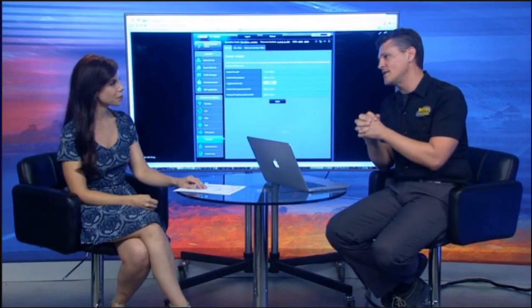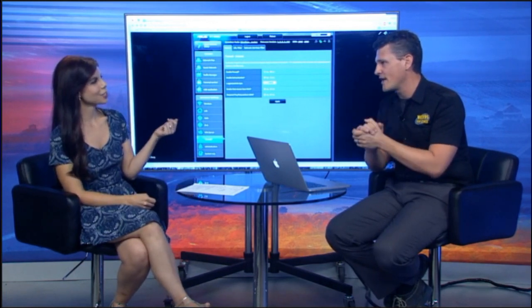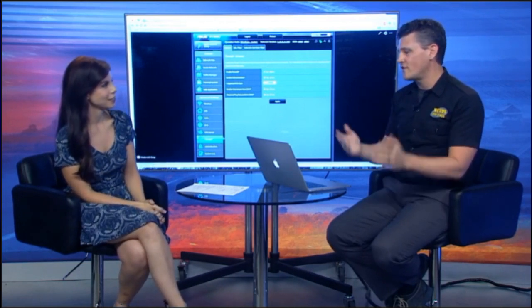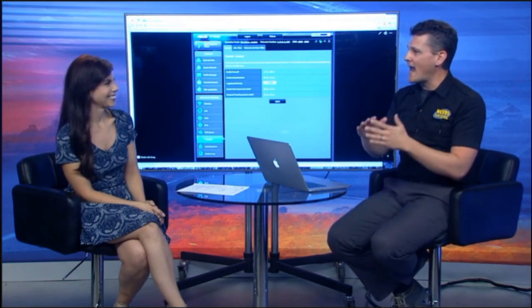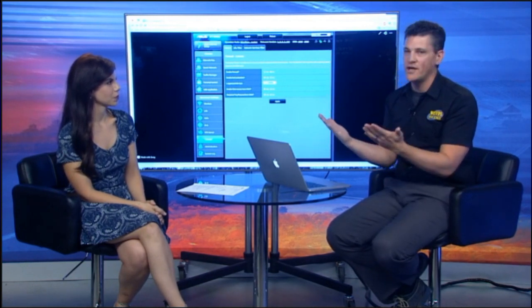Once you're done with that, you get to choose your encryption type. There are several different kinds and it looks like alphabet soup, but choose WPA or WPA2 — those are the most secure. If the only option you have is WEP, you need a new router because WEP is super easy to crack; just about anybody with a Wi-Fi card can get in. You can drive up into any neighborhood and instantly see who is protected and who is not. It is trivial — with just a few keystrokes I could get into a network. In an apartment complex, if your router is named Linksys or D-Link, people may connect to your network by accident, thinking it's free or one they've been on before.